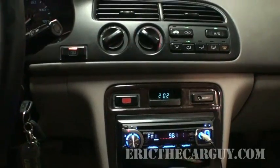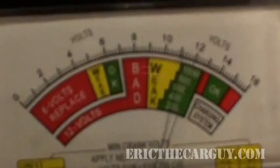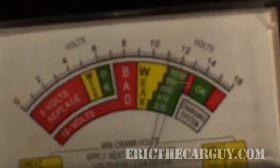So we've turned on just about everything we can turn on. Now that all that's on, let's see what kind of voltage we've got — looks like right around 12 volts. It's not going under; it's right at 12. That'd be a good alternator. So you saw with everything on in the car at idle — worst case scenario, stuck in traffic in a rainstorm, bright lights on, radio on, rear defogger — everything — it was still hovering right around 12 volts. I should have cracked the idle a little bit and shown you it would have gone above that, but if your alternator can put out 12 volts or above at idle like that, it's good.